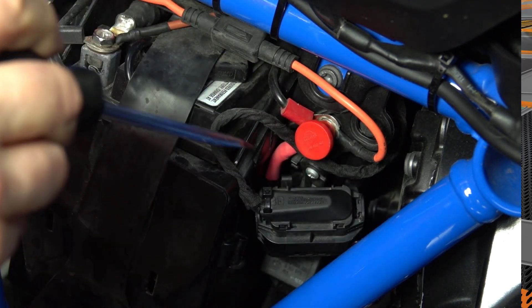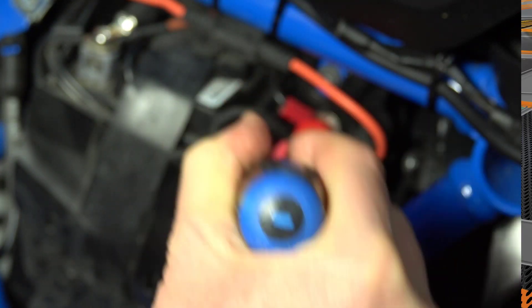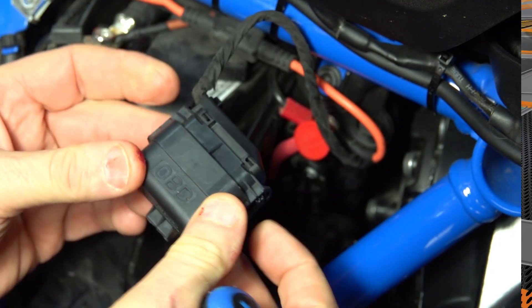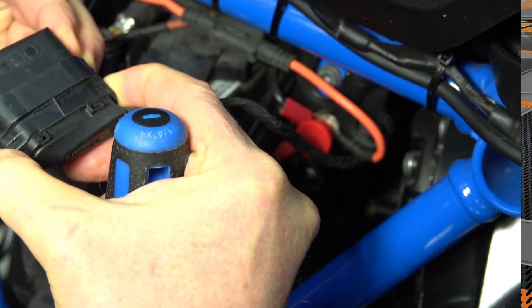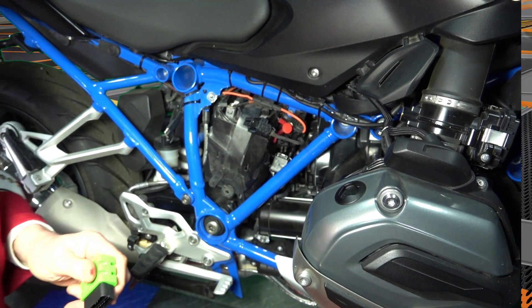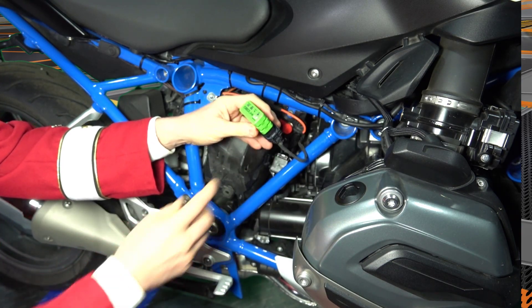The first thing we're going to do is take a flat head screwdriver — you can see there's a little clip here that holds the whole unit on. This unit basically pulls off — it just slides off this slider. You can see this slider in the back. Then we have the unit here, which has two spring-loaded sides, where basically we can push in and pull it apart. So we expose the connector. Once we've exposed this, we can plug this Bluetooth in, and you can see that it's got some power.